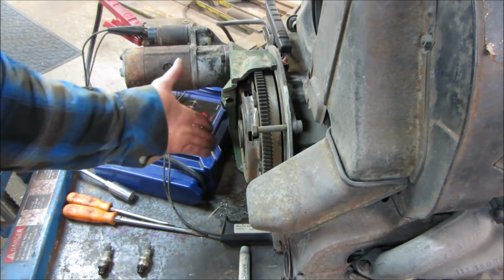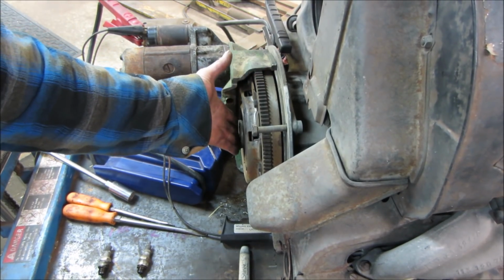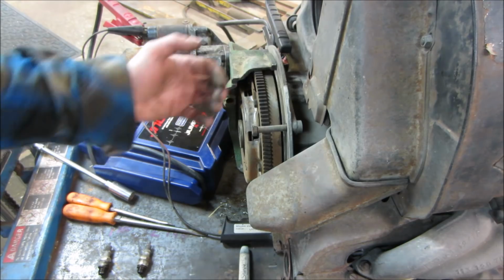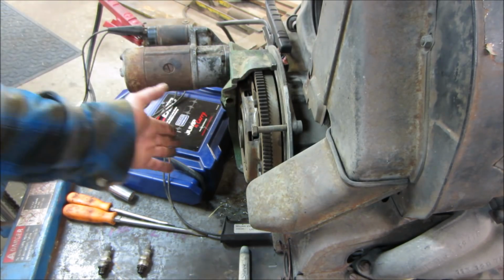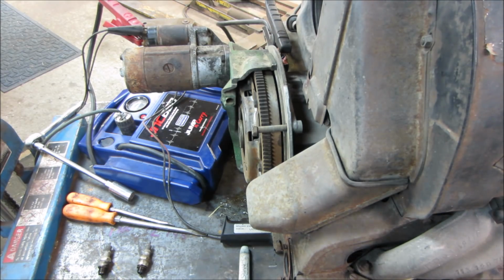But if you sit there at a light or whatever and ride the clutch, you push the clutch a lot. When you're sitting at a light, you're literally pushing on the end of the crankshaft. The engine is spinning and you're pushing the crankshaft, and over time that can cause end play, or crankshaft play. Automatics not so much, because an automatic never has that issue, so sometimes those motors survive much longer. Also, was it a city car going through the gears a lot, or something cruising on the highway where you took your foot off the clutch? It could have a lot of miles on it but won't show that wear.